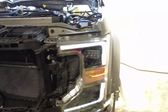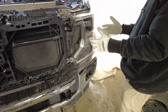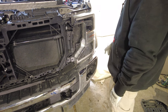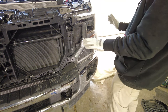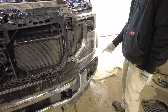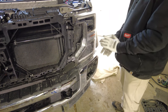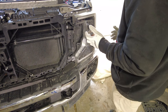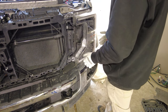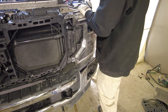There's only one good way to finesse these headlights out of here. Up over here there's a little gray screw, and there's a clip up top you need to be aware of once you've gotten all the fasteners loose. There are two fasteners up top and one on the side. If you've got a 450, you've got to take off this trim in order to get a 13mm in there — otherwise it won't fit. Once everything is unbolted there's a finesse you have to know: it's not just going to slide out nicely.